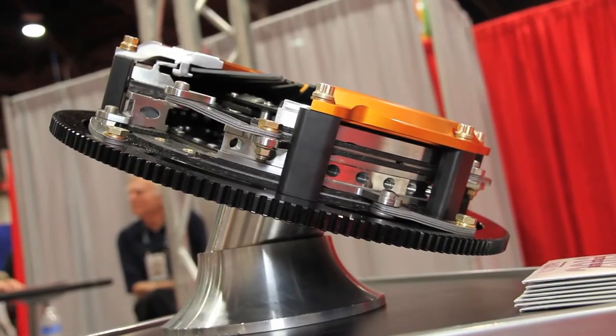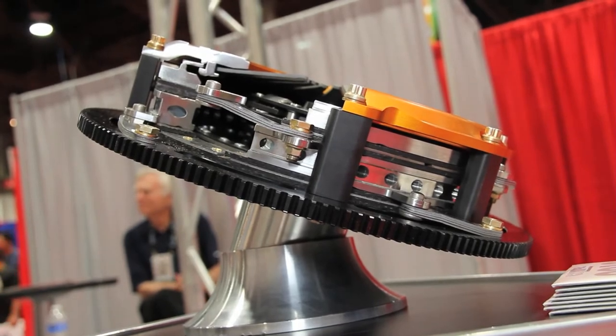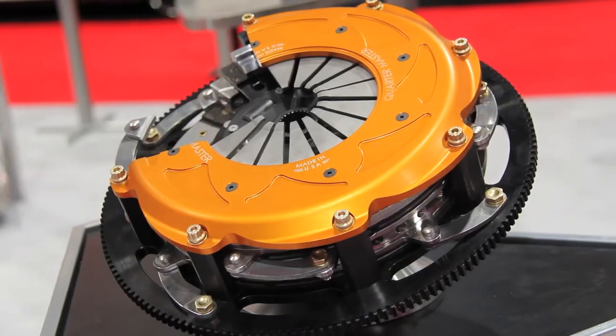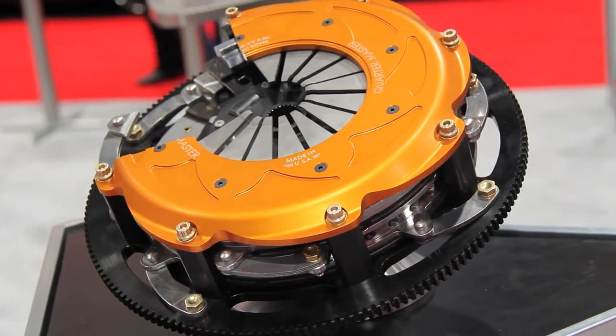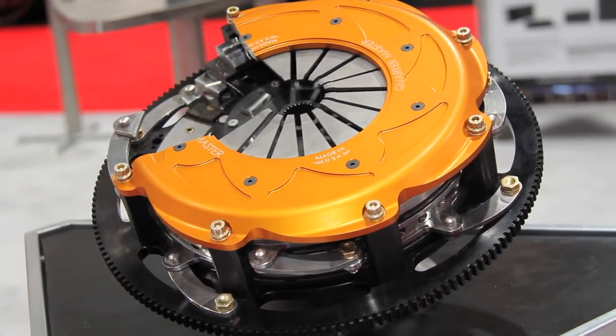How did you achieve such a soft pedal feel? The magic to a good clutch is making the drivability right. We had to make this thing actuate and feel like it was just about stock — you need to be able to disengage at high RPM and high torque, and grab and hold high horsepower and high torque. All that magic comes into the clamping force and the spring engineering. We put about a year and a half of effort into getting that right — a lot of seat time driving too.